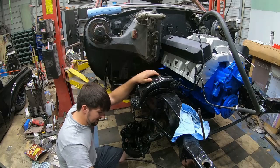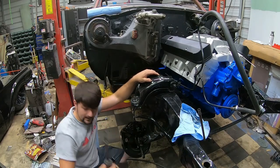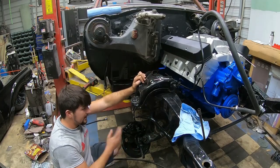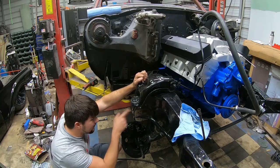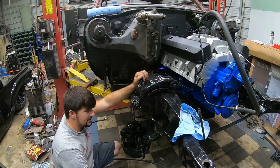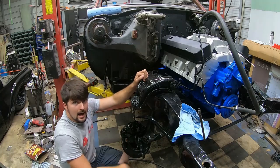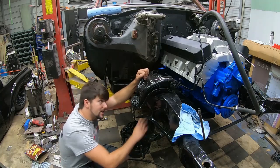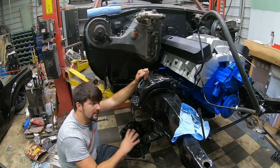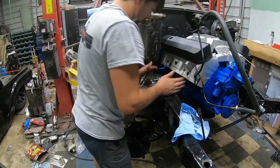But as you can see, my spring is now out. Throw that out of the way. Go ahead and get my shock, move it over to the side. Now my control arm is sitting here dangling, so I can take out the 2 bolts in the rear, take out the bolts in this upper control arm, and this side is already taken apart basically. And since the spring is out, I'll get some rust to black and spray that on the inside of where my new springs are going to be sitting, because we want that to be nice and pretty if anybody ever looks up underneath it. So now, I'm going to take these upper control arm loose.